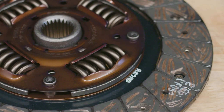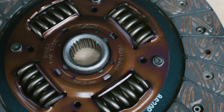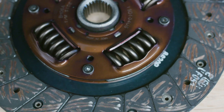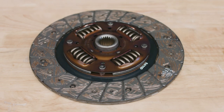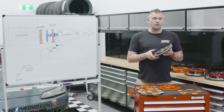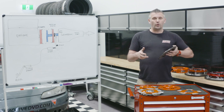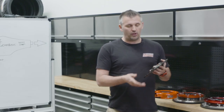The next thing to talk about is the material. You hear about the phrase 'an organic full face clutch' — this is what you're going to find in 99.9% of factory cars, and even for a basic upgrade you can still use this. Why do we use these clutches? They're just very user friendly, very soft and progressive in their engagement, and really easy to drive. But on the flip side, they just don't handle heat very well due to the type of material they use. They can warp, distort, break, get stuck, or fuse to the flywheel if you abuse them too much. So they just can't handle abuse or heat as well as other materials.